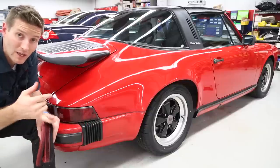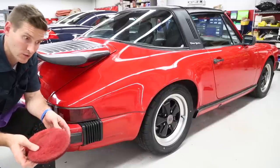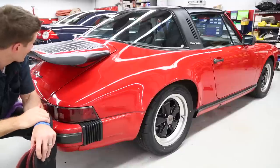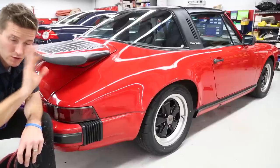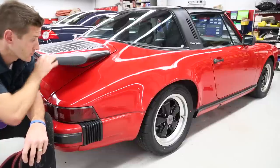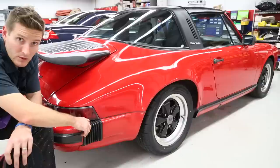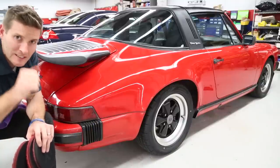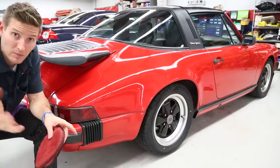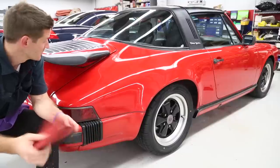The big theme of the day: can you polish or compound by hand on single stage? Yes. Do I recommend it? Not particularly, especially if you have tools or means to obtain tools — it's like digging a hole with a spoon versus a backhoe. But it came out pretty good; you just have to take your time. On the trim — and we'll do a whole trim video — you have to protect it. This is very soft, porous plastic and trim. When you're compounding, compound gets stuck in there and it's a pain to get out. I used all-purpose cleaner with little brushes and stiff bristle brushes to get everything out, dried it down, then used Black — a product from my buddy Richard Lynn, a great product I got from Detailer's Domain. If you have any questions shoot me an email at larry@ammonyc.com. Thanks for watching, see you next week.